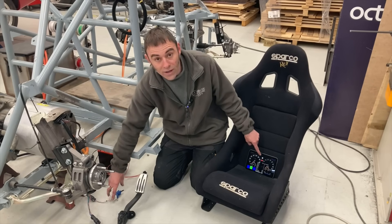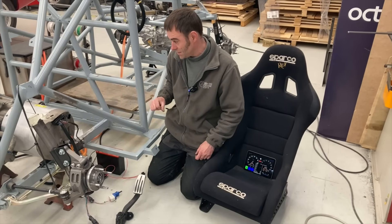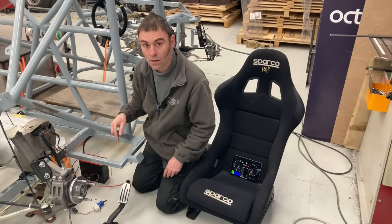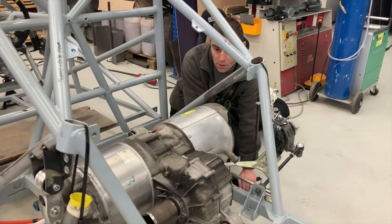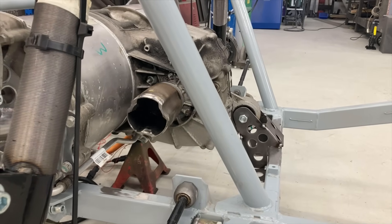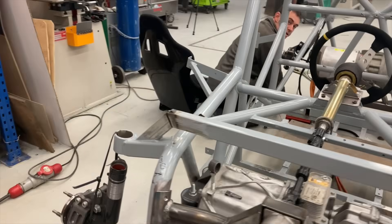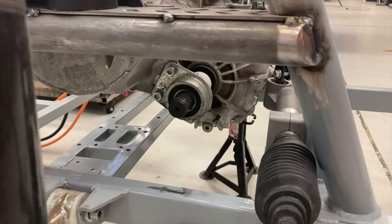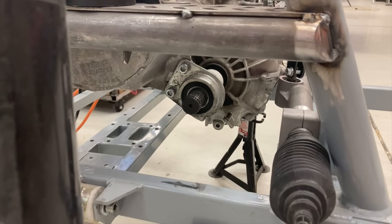So I'll switch the brakes on and off — there you go, you can see the brakes going on and off. You've got to have your foot on the brake to change direction, so I'll go into D for drive. Can you go around there, Tim, and see which direction it's going? This should be going forwards, so if I press the accelerator you should see the drive shaft coupler turn. When you're ready — hey, that's forward! Yeah, it's going forwards! Cool. Check the front then — see if that's going in the same direction.